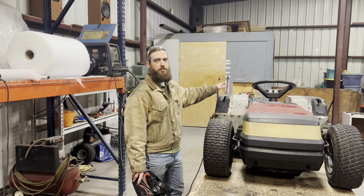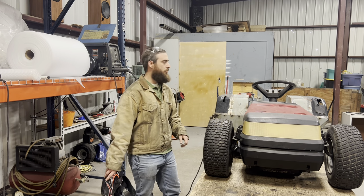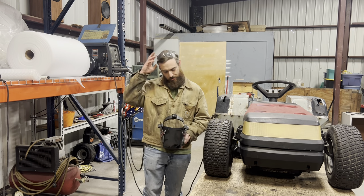If I get it too hot too fast, I'm gonna end up with some bending and a lot of warpage. So I'm just trying to avoid that altogether. Keep it cool, tack it all together, take my time. We'll see how it works.